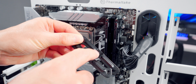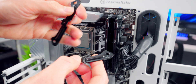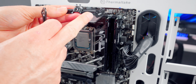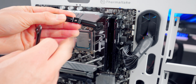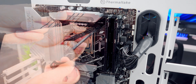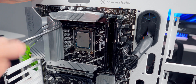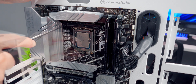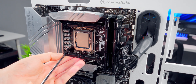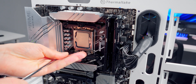Next, install the support brackets — that's what the cooler actually mounts to. For LGA 1700, use the outermost holes again, and make sure the little notches or bump-outs are facing inward towards the CPU. These get screwed down with two screws each, one in each corner. Go back a second time to make sure the screws are nice and tight, because this is what's really holding the cooler on there — you want nice, solid, consistent contact right on the CPU IHS.